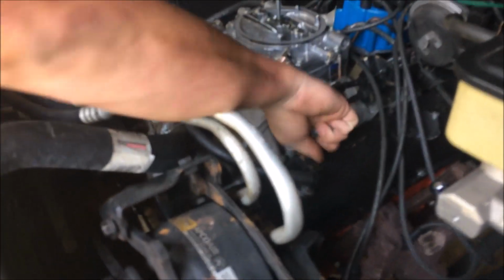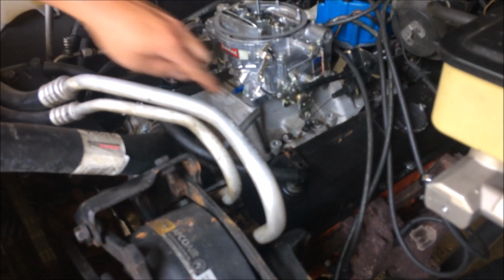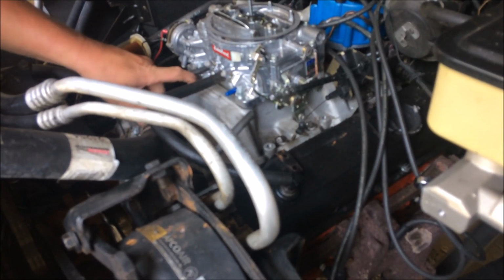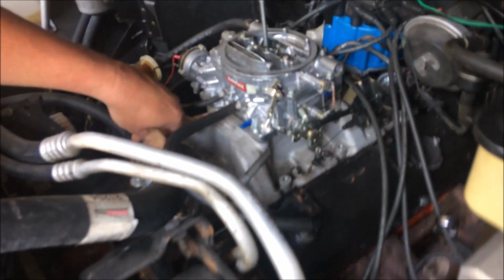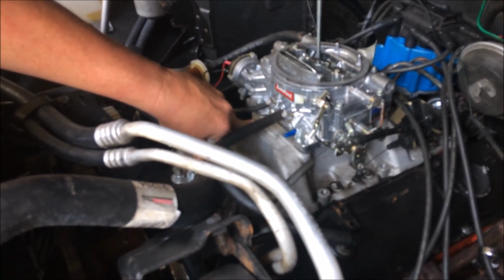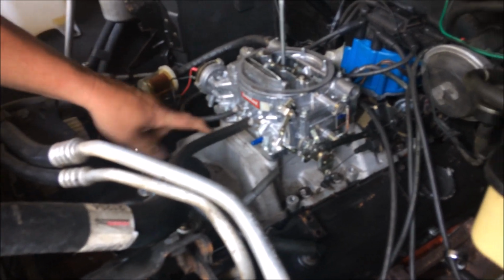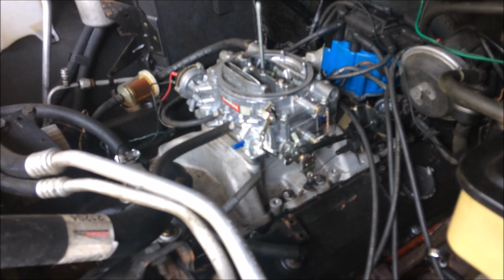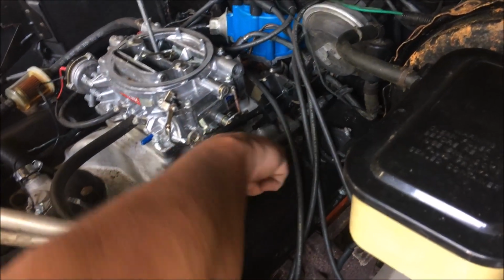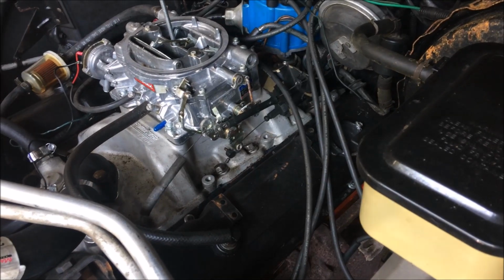Okay, look. Number one, look at them bolts. Now, there's no way that them bolts line up. That intake's for a 94, 95. It's for the Vortec motor. It's not for the old style Chevrolet. See how bad them bolts are? See that? The angle ain't right. That's the Vortec intake.